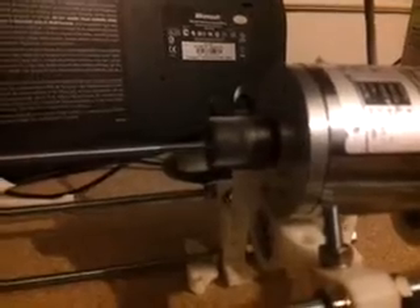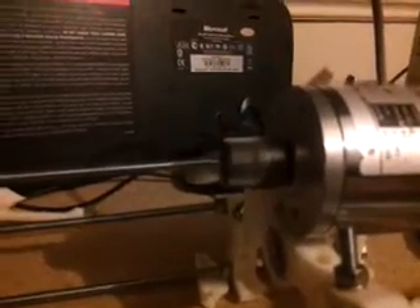If we turn it on and have a look — let's put it on low — it runs. My first thought is it's so quiet. It also wobbles very slightly; I don't know if that's a small amount of vibration. I think the gear that was pressed on there for the gearbox is slightly off-center, and I can't actually remove that gear.